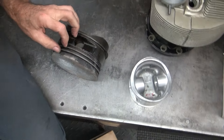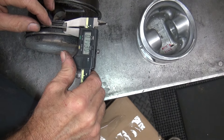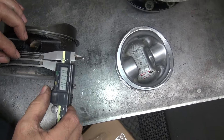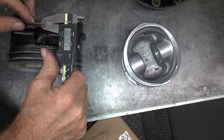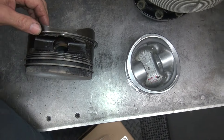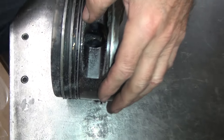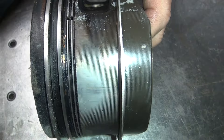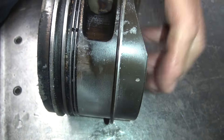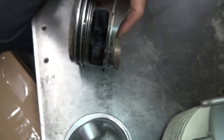Still has rings with it. How fat are those rings? They're fat rings — hundred thou. Some are nineties, they're variable. One's a hundred, another eighty-nine, that's ninety-one. This one's a hundred and five. And the oil ring looks pretty cracked — looks like it's frozen in there, doesn't do anything. It's a one-piece oil ring with a shitty expander on it. There's no tension on it. Look at all the oil blown by it.